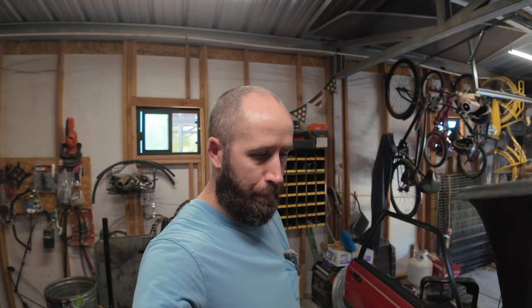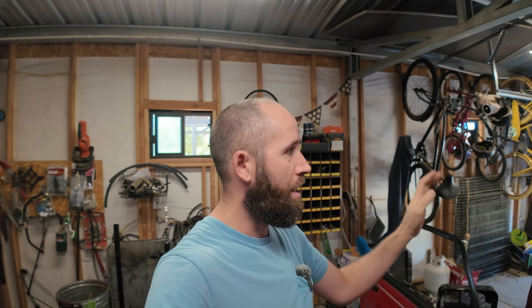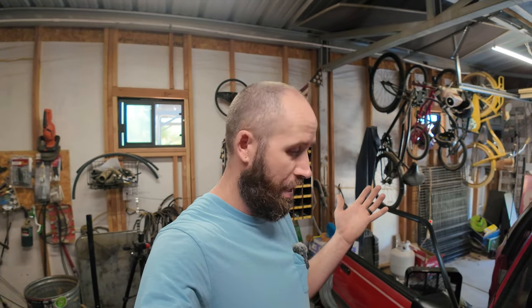Wouldn't you know it, it idles beautifully. It still has a little bit of surge under load, but it's fired right up. No surging, still at 1,000 RPM, so I'm gonna go through the entire process all over again once we get this MAF and that throttle body, because I have to anyways, and set the base idle. I think this might have fixed it.